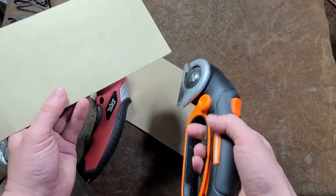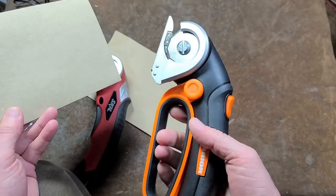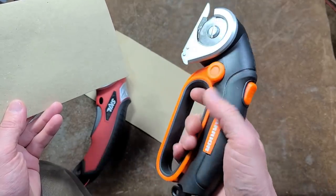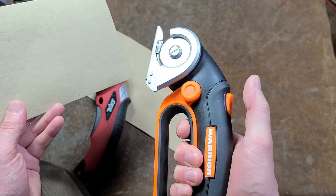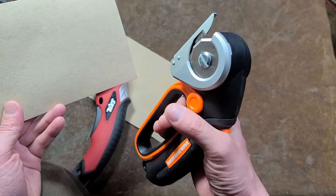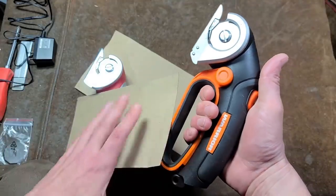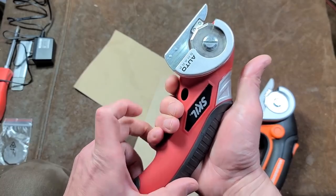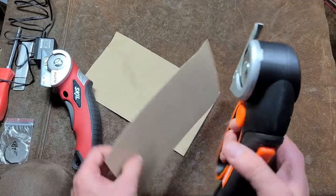They work great, except this is such a weird system. The Skill was just a mechanical lockout and works normally. The Warrior uses a weird latch system — you have a safety switch here. If you press it without holding the handle, you don't get any action. This is a latch, which means it's an electronic button, but when you press it, it acts like it stays on. To turn it off, you have to actually release that. Part of their idea was that you'd choke it up and grab it like that, but that's just terrible ergonomics because this handle is pushing your fingers too far back. On the Skill, you put one finger up in front of the trigger and it allows you to get a really nice purchase on that.